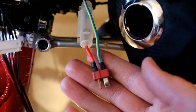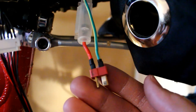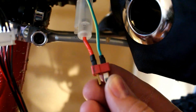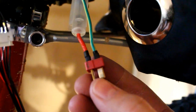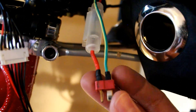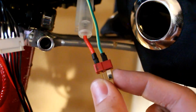To power the system, the kit comes with a very basic generic battery connector. Since I'm using Deans connectors on my batteries and series connector, I took the ground and power wires, snipped off the generic battery connector, and soldered on my own Deans connector.